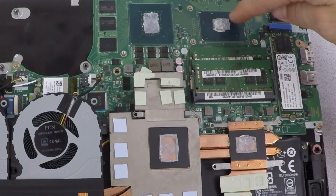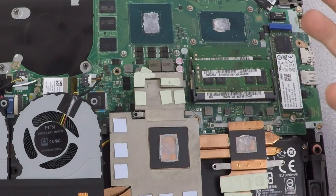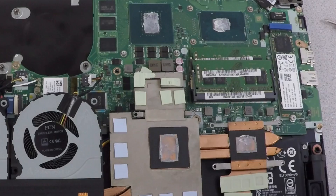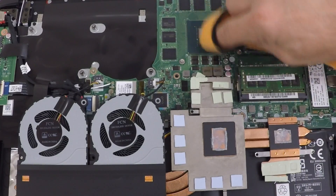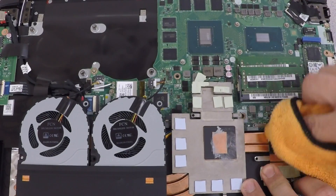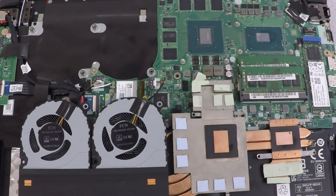Something I noticed on the laptop was the paste was very patchy and dry. It didn't look like it was making really good contact and it was lightly applied — normally with manufactured laptops you see a ton of paste everywhere, but in this case it's not. I'm going to take 91% isopropyl alcohol and a microfiber cloth and remove this terrible paste, working around both the GPU and CPU die and the copper heat sink, making sure they're really clean with no oils or old thermal paste.